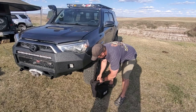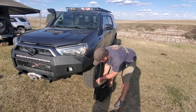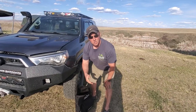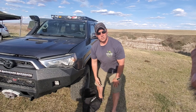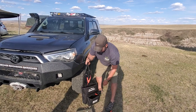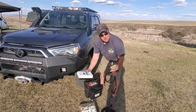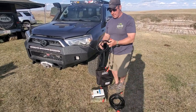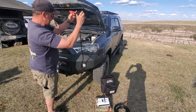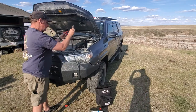The bags are actually made by Overland Gear Guy out of Salt Lake City. This is our 16 and a half foot extension cable — we use 10 gauge cable with that. I've used up to three of these together and had no loss of amperage or attenuation. The other devices that come with it: we've got our battery clip cable right here, and this specific package comes with a 20 amp MPPT solar charge controller. Everything's color coded — red for positive, black for negative. There's a 30 amp inline fuse here, which you can pop off and replace if required, just for safety.